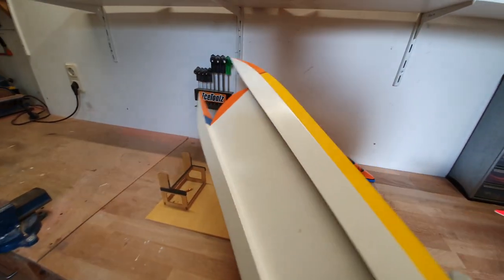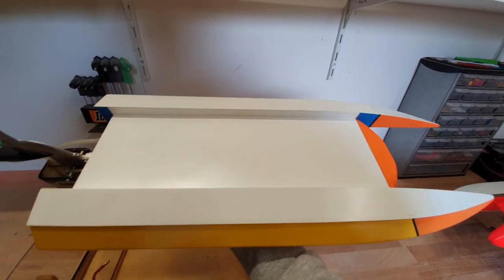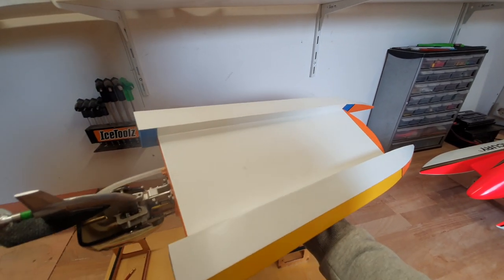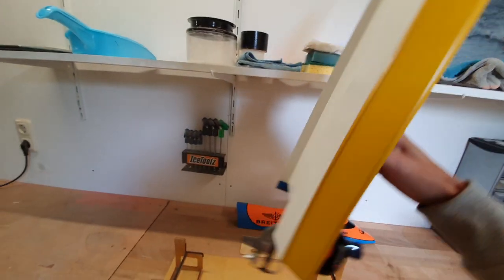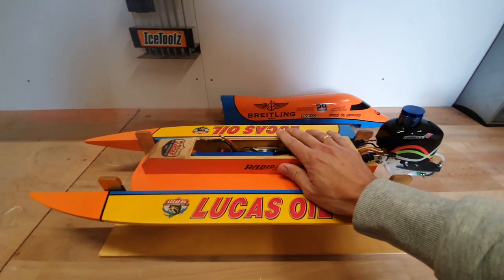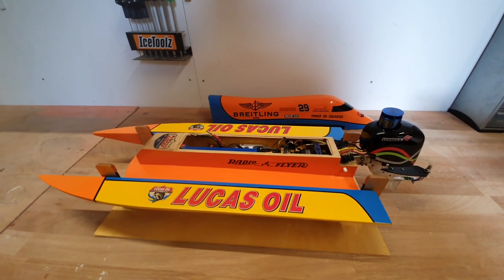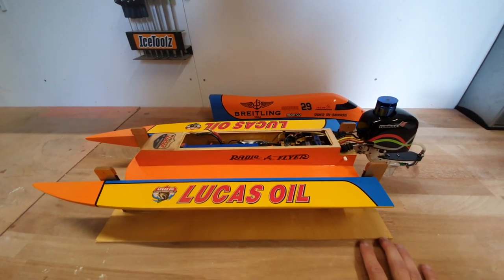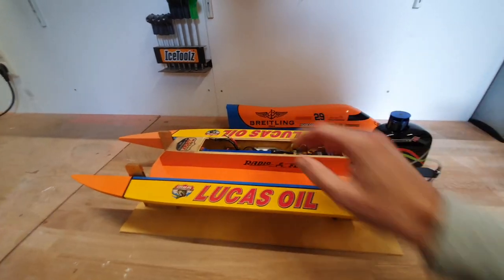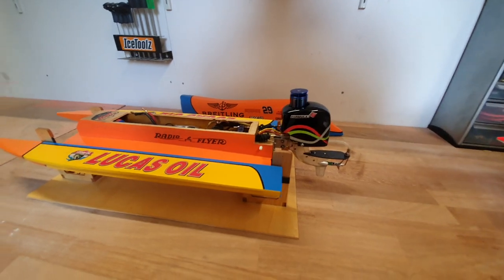I'll show you the bottom side of the hull. As you can see, the sponsons are just straight — no air gaps, strakes, or anything like that — so it's relatively easy to build and the hull performs quite well. I'm really pleased with the performance. Besides the top speed, the cornering is also quite nice — aggressive turn-in, just like the real F1 boats. Once on speed, the hull runs really loose from the water, almost entirely free, with just the last part of the sponsons and the outboard touching the water.